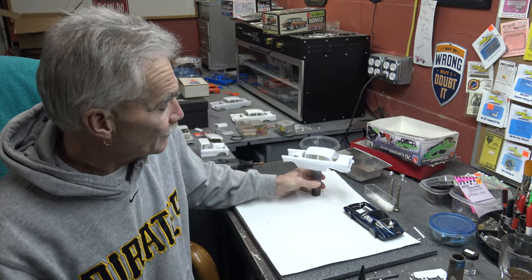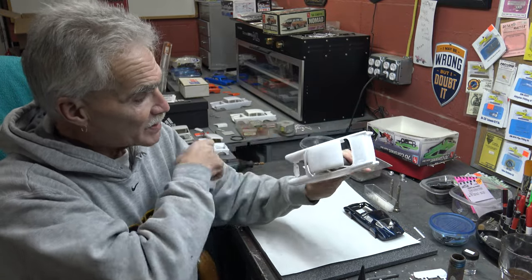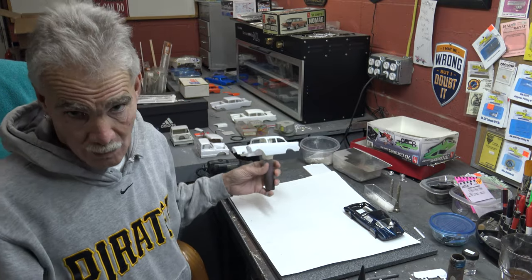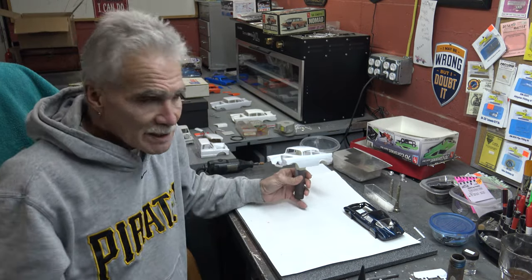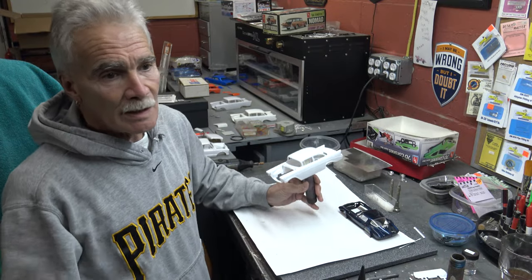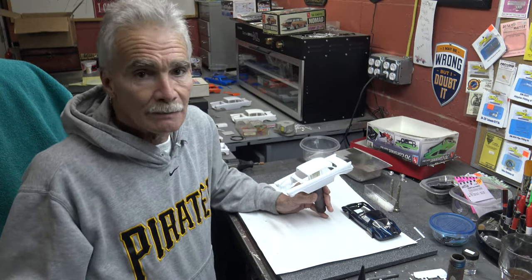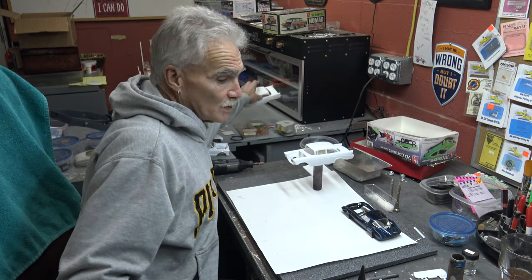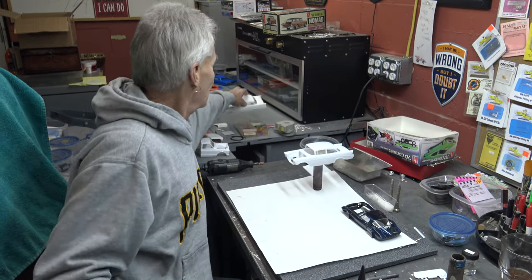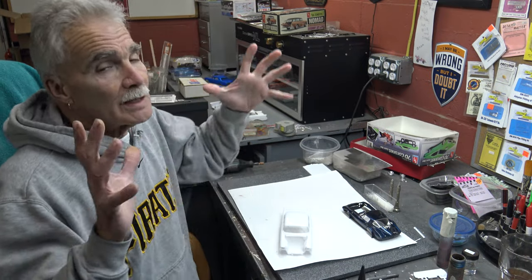Why do I prefer this? First of all, you've got complete control. You can turn this, you don't have to worry about anything — you can get at it from every single angle. Also, you've got more room. As you've heard me preach many times before, you've got your cabinet. It's a great day for painting: 68 degrees, no humidity. You've got all these prepped bodies that you prepped up in the winter, so now you're going to have a paint day. Put it there, and the next one's on the nipple next door to it, and so on and so forth. Once they've flashed, peel them off, peel the tape off, throw it back in the box. You can't do that setting on a hanger — you can't turn your body.